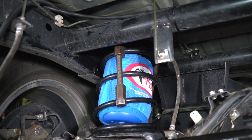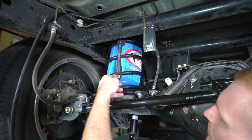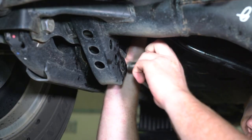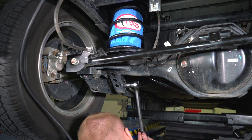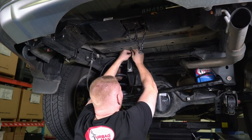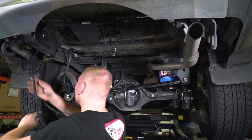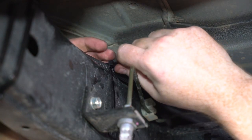Lowering the chassis will allow you to safely remove the coil compressors from the coil springs. Locate the shock back into its lower shock mount position and tighten using a torque wrench. Using the supplied cable ties, route the airline away from any sharp edges and heat, to the rear of the vehicle where you have mounted the inflation valves.